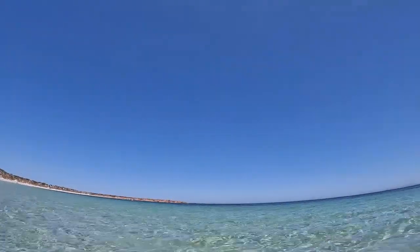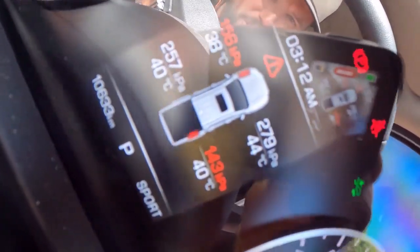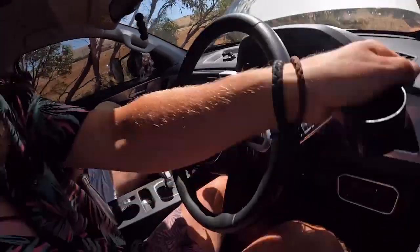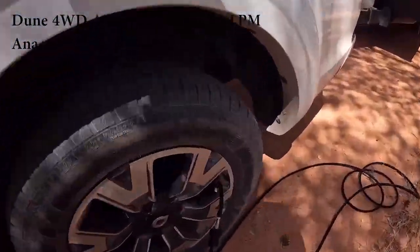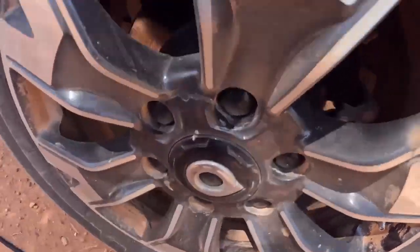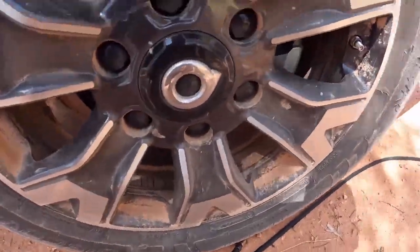See you later. Peace. I'm just pumping the tires back up, and I just noticed that I can use the tire pressure warning system gauge thing. Sorry if it's on its side. But I can go and sit back in the air conditioning while the tyres pump back up. And when it gets up there, then I know to jump out and go and turn it off. So I double check it. That's pretty handy when you're using one of these little devices. It takes a little while to pump your tyre back up. But now it just told me that it's at 40 PSI or 280 kPa. And then I can double check on my little gauge. Right. It's just there, 40 PSI.